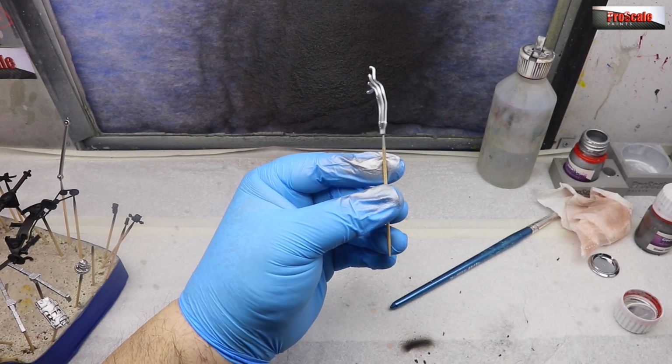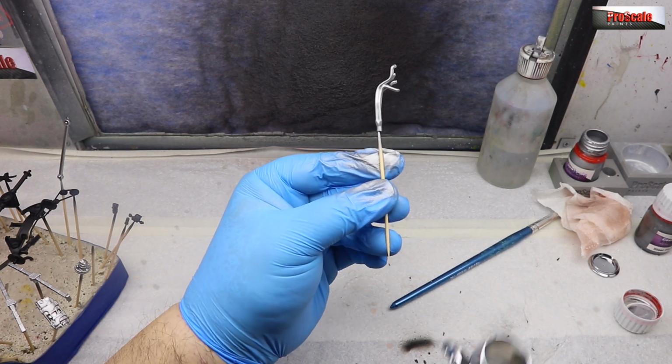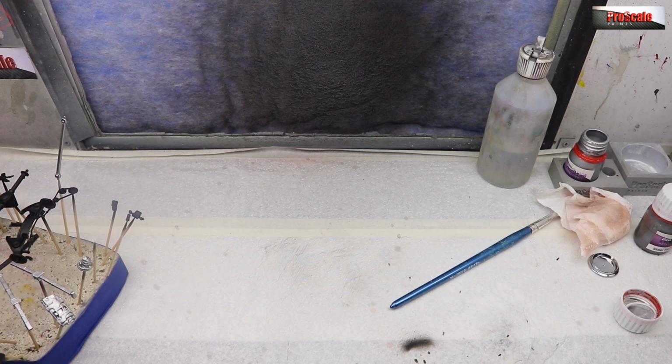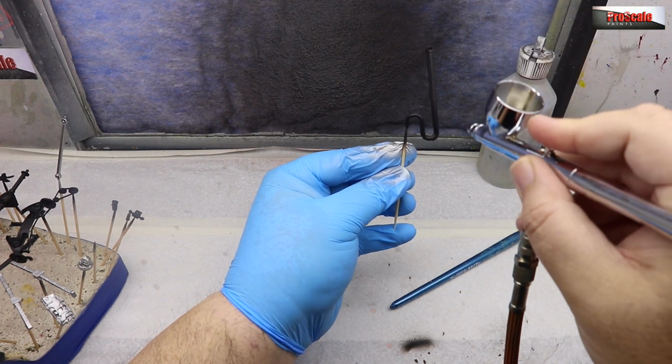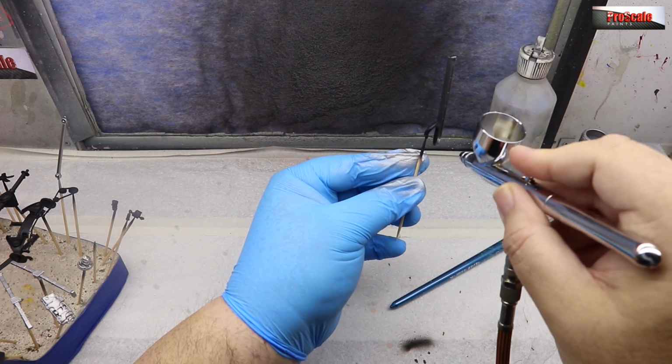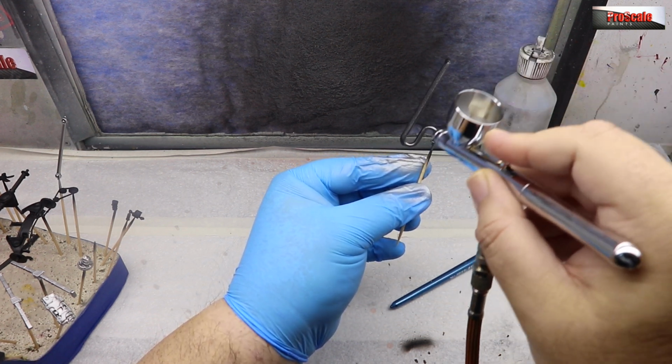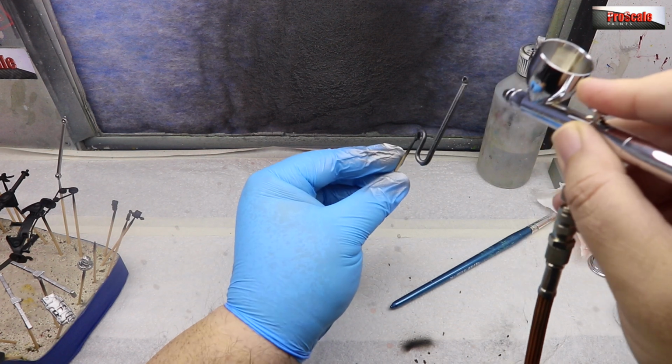Looks like I'm spraying a lot of paint. There's barely anything going down there at all. Just build it up nice and slow, let it flash off, and then bring it back for another coat. And as you can see, we've got all the other engine components painted up. The exhaust are being painted up, our leaf sprung suspension's done. Going together really well.